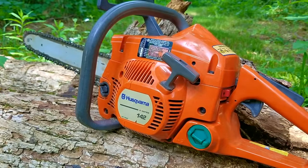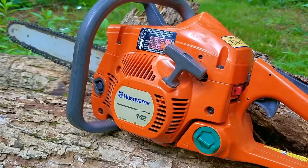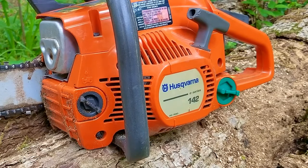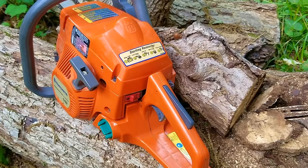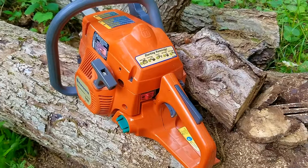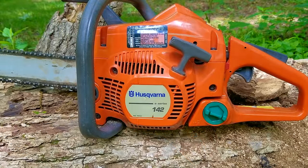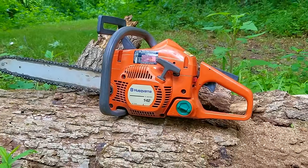After adding more fuel to the engine by turning the L screw counter-clockwise a total of half a turn, this chainsaw is now running much better. I would have made adjustments to the H screw if the saw was having a hard time and bogging down during the cut, but that never happened so I didn't feel it necessary. Another option as to why this chainsaw was leaking fuel would have been a bad carb — in that case, I would have tried to adjust the rocker arm and inspect the metering diaphragm, but to be honest, replacing the carb is a much better idea because it takes all the guesswork out of it. So in the end, this saw didn't need much to get it running again, but we went ahead and replaced the items that would have eventually failed and tuned the carb so the engine stays running like it should. Did I go too far in getting this chainsaw running again, or should I have just reconnected the loose fuel line and tried to adjust the carb with the blocked inlet screen? I'm sure I would have had a hard time tuning the carb if I had gone the easier route.